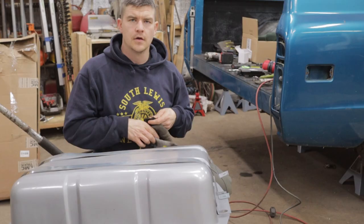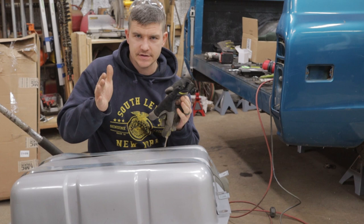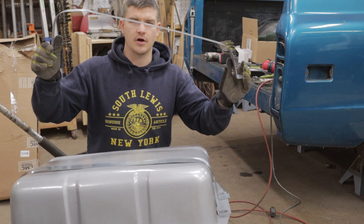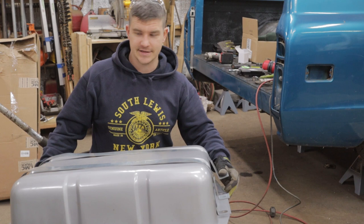We're rolling in the home stretch here, fitting up the tank, and I have a bunch of knowledge bombs dropping on you right now, so focus on this video, because there's a lot of really cool things I'm about to show you. First thing, I don't know if I mentioned this at the beginning of the video, but as I said, these tank straps come all wonky packaged. I've even seen them folded in half, so you're gonna have to bend them to fit the tank. Now is a really good time to do that. Once it's under the vehicle on a jack, not so good.